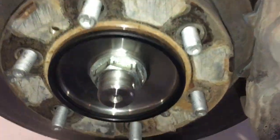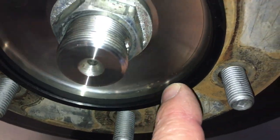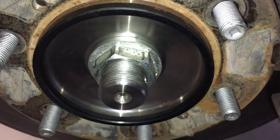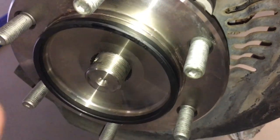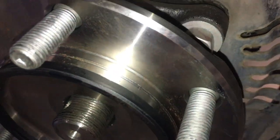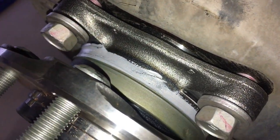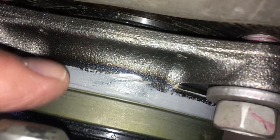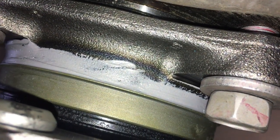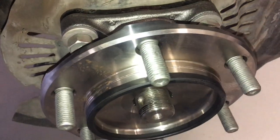Let's have a look at the new ones on the car. On the passenger side you can see it's all clean - no rust, and that's the way it's going to stay. See this black coating here between that and the dust cap? That just seals up awesomely, and generally I never see any moisture in here whatsoever, which is the way you want it. Over this side as well, it's all just slowly going back together. What we do with our assemblies - this seal is metal pressing over metal, and it seals pretty well. So we run a bead of RTV silicone there, and that seals up 100%. If there's a little bit extra we can do to make it last longer, then bada bing, that's what we do.